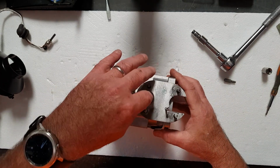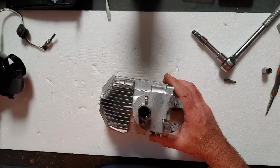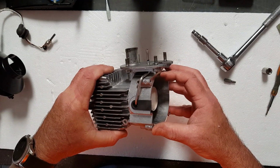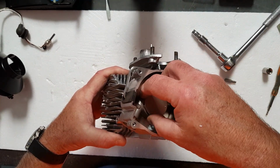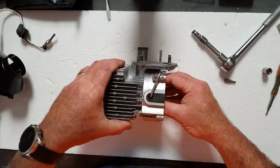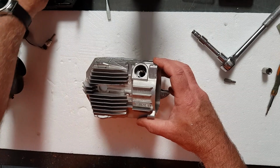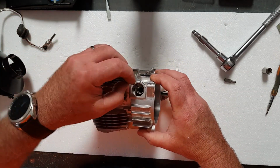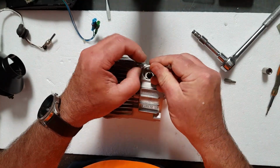So we've cleaned out the exhaust port here. The air intake, of course, is in the other section that's come, which has been pulled apart, which is the fan area. This area here is where the air is drawn in to help with the combustion inside the burn chamber. So what we'll do now is we'll get our little sintered screen, and we'll get our nail, make it a bit easier to put it back in.